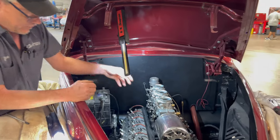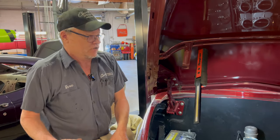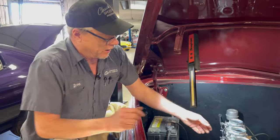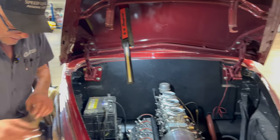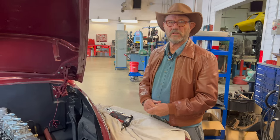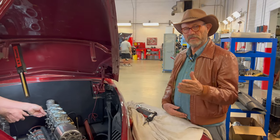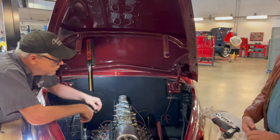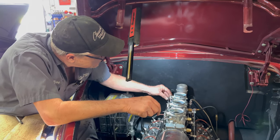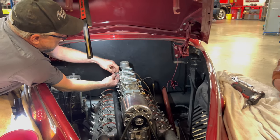Yeah. Okay. Because if you overfuel it when it's cold, very quickly you're going to find out the plugs are all going to turn very black and sooty. Right, which means that they won't fire properly. And you're going to get a misfire out of that because the plugs don't fire well. Right. A lot of this stuff is taken up in automatic choking equipment in modern cars. We don't have that benefit, so we got to live with that. And we got to kind of design the system a little differently so that it functions in a variety of settings. One is startup, it could be really cold. Mm-hmm. When an engine's running, it's running hot. That's a totally different thing.